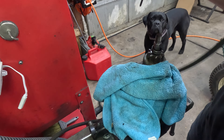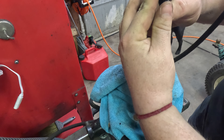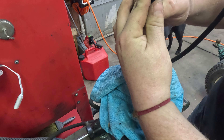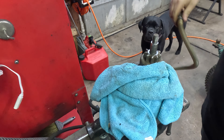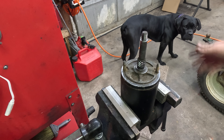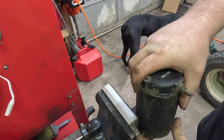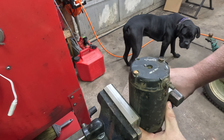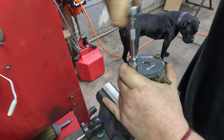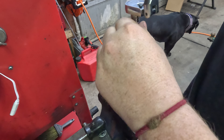God dang the stool — success! We got our Bendix off, we got our dog here. Now we got to flip the starter over and take out these bolts right here. Let's go ahead and take these bolts out. Now these bolts are long — they go all the way through the starter.